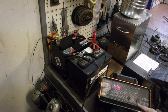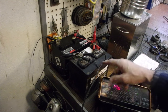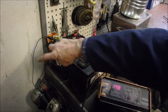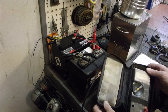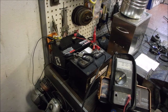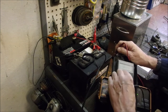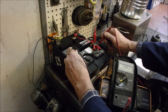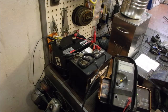Here's a good little lesson on battery charging. Right now I've got the battery charger connected to this front battery — they're little yard tractor batteries. At the same time I've got two leads connecting to the back battery, so this little charger is charging both batteries at the same time: two blacks going to the back and two reds going to the back. Using my digital meter on the front battery I'm charging at 14.83 volts and the back battery is charging at 14.59 volts. You would think that would be impossible because they're connected together.